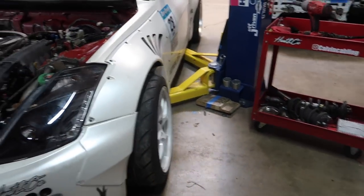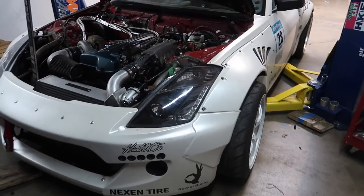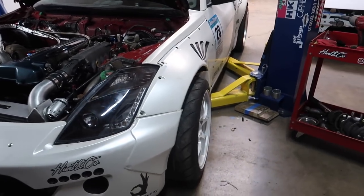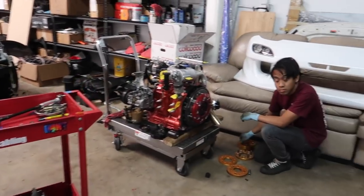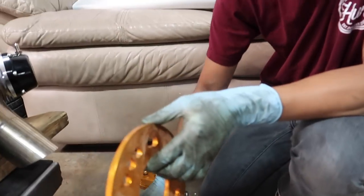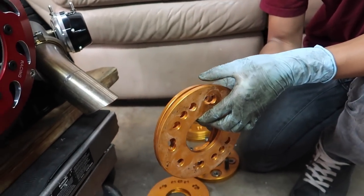We just made a new discovery — just making tons of discoveries with this new wise fab kit. We just lowered the car for the first time and the inside of the wheel literally makes contact with the top of the A-arm right here. It's full-on touching, and we're poking out quite a bit. We're debating spacers — one person suggests 10 millimeters, the other wants to push 20. The concern is you don't want just a little bit of space because the wheel and that spot move on the same plane.